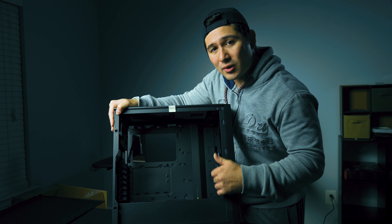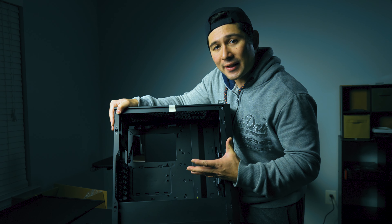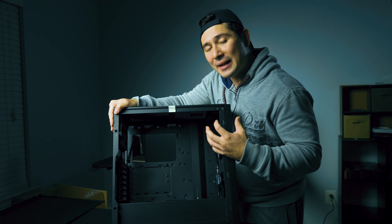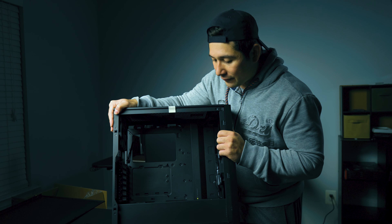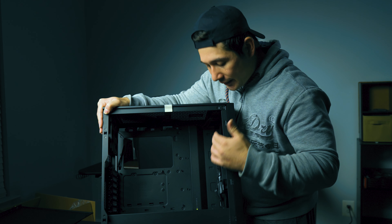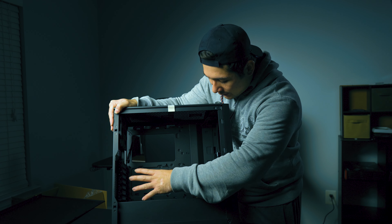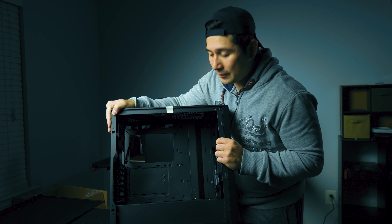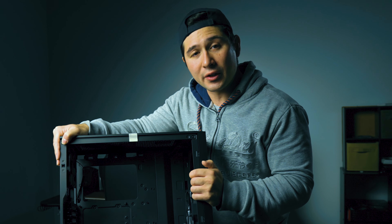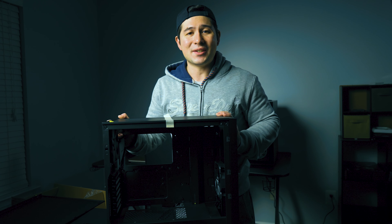This case is not large enough to have side fans since it is the 4000D, but it is specifically made for airflow. Corsair does include cheaper fans that don't feature RGB, but if that doesn't matter to you, it's one less thing to worry about. I'll probably add one more fan at the bottom — maybe a Noctua fan — since these are non-RGB, to go for a more silent approach. On top, we'll use a pull configuration for the CPU cooler.